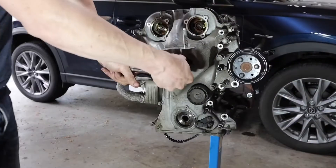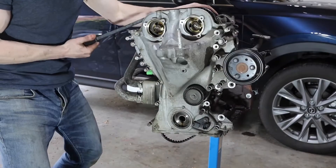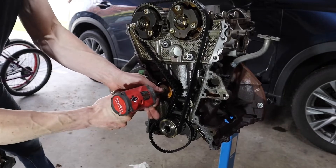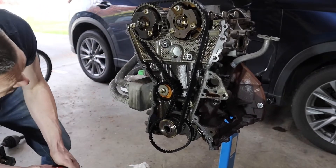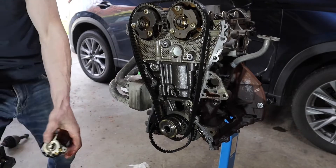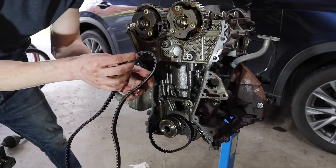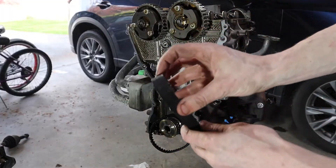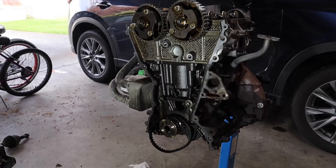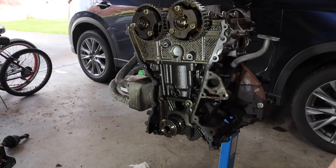Super important, you've got to get them all. We're doing pretty good here, I think we could have this head off pretty quick. Ew — wet timing belt, guys. Why is that even allowed? This so-called lifetime timing belt is starting to show its age — look at the cracking. Yeah, this belt was ready to fly apart. Why, Ford?